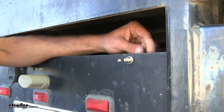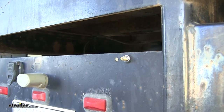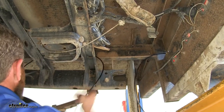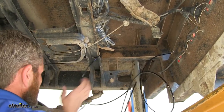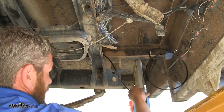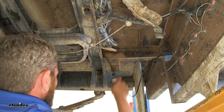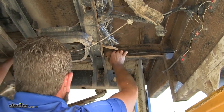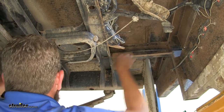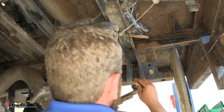Once you get a nice secure fit, we're going to go to that back side and start routing that line to the passenger airbag. I'm going to route my airlines back — this has a flat bed so it's pretty much a direct shot. If you're using a regular pickup truck bed, route this so it's not going across any sharp edges. You don't want it by any significant sources of heat. When we get by the exhaust, I'll show you what they've provided to help with that.